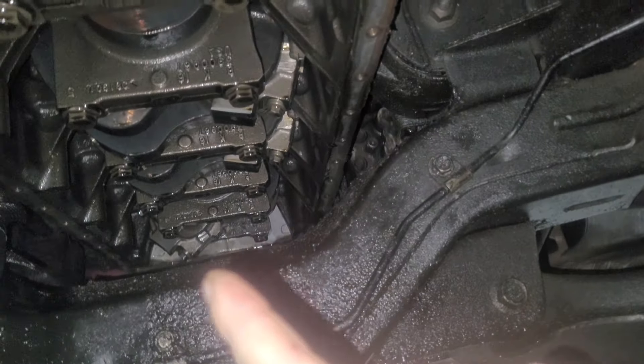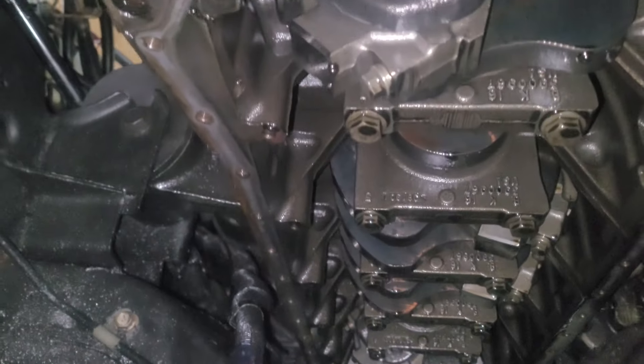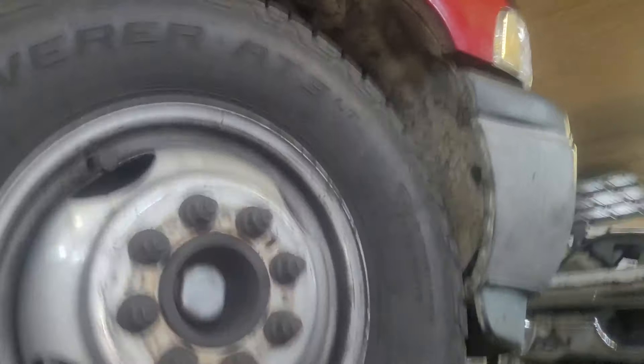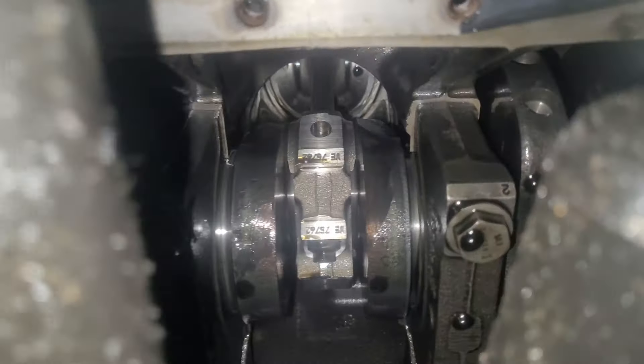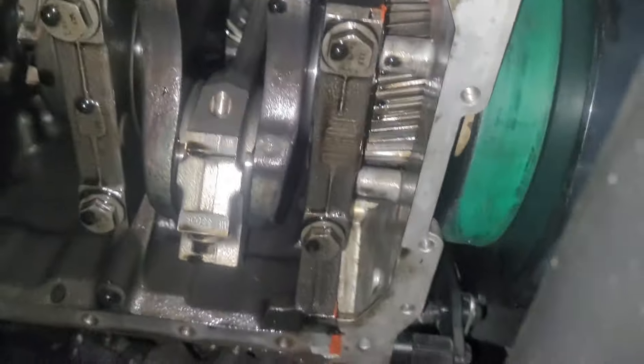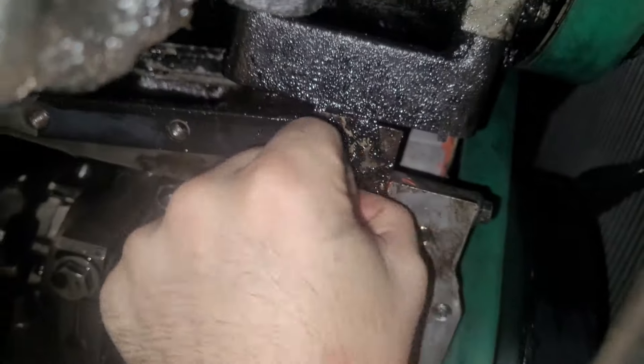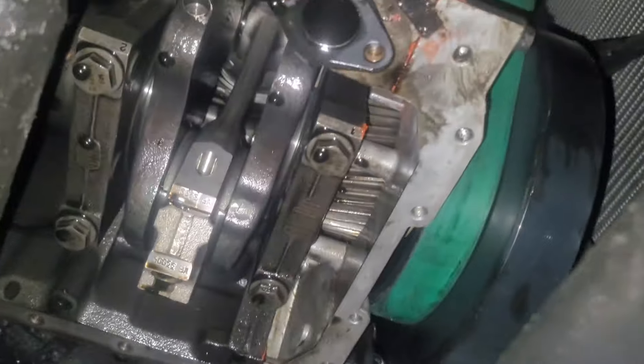I really don't think we'll see anything yet. I'm going to have to get up under the front — it should be one of the first two cylinders, either the back of the first one from the crank. I'm going to look for any marks on the crank as well, probably right in that area. Took my gloves off so we're raw dogging it right now. Okay, so it looks like you can see some discoloration on number two. I'm going to spin this over and get all of this gasket material off clean so it's a nice new surface. I don't want any leaks or issues, and I know this thing was leaking before. We're also replacing that gasket right there.